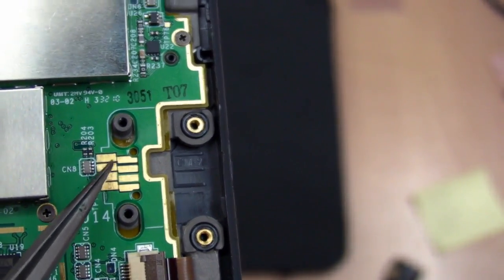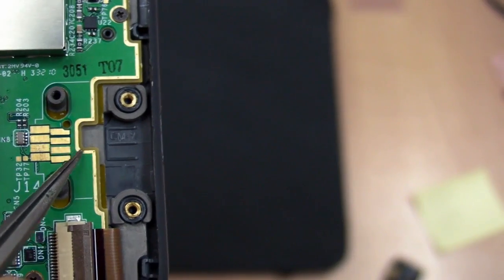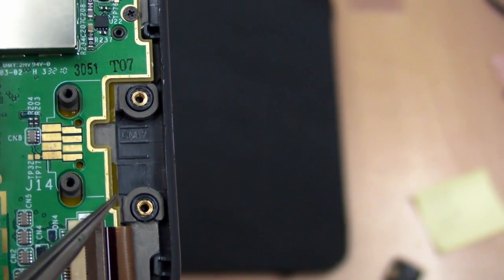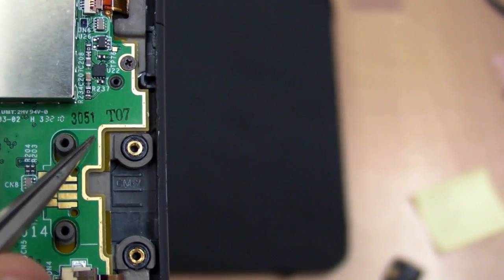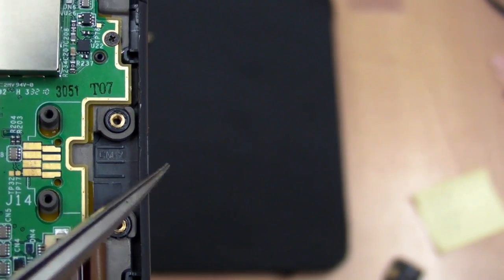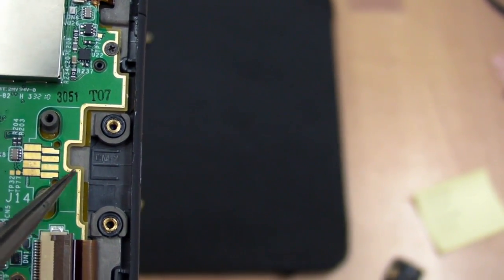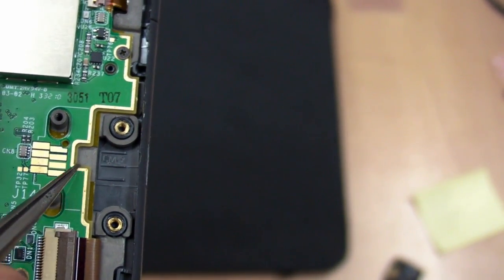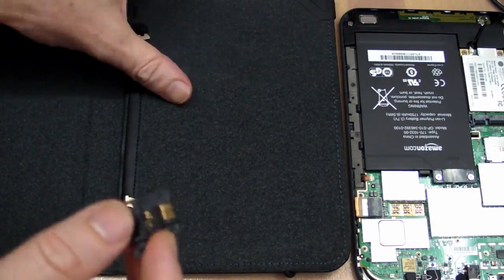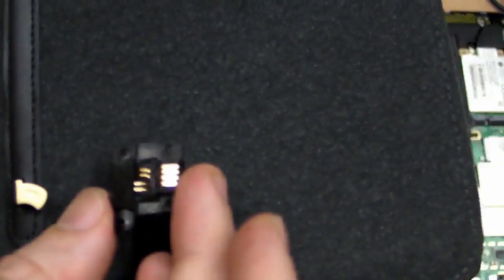As you can see, this one is actually grounded — the second pin from the bottom is ground. All this exposed gold-plated copper along this outer point is all connected to ground. So we don't have to worry about that retention clip from the case shorting out the ground, because there's nothing else in there for it to short to. The only thing it can possibly short to is physically inside these four contacts inside the connector. So let's actually plug that up.